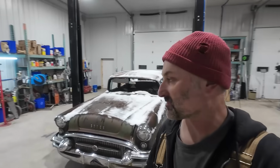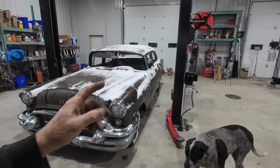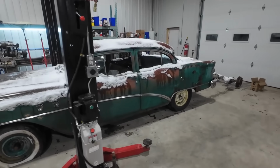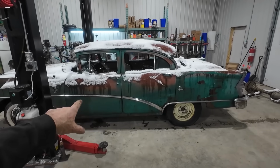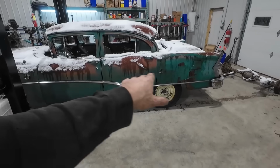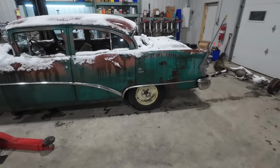Folks, you see me bring this thing in, that only means Austin's coming out, and tomorrow we're gonna start blitzing onto this thing. I think what I would really like to do is get the four bar into the rear so that the car's properly mobile. I know the last time we moved that, people were talking about how the diff is kind of doing a little dance, and because we don't have the original powertrain in there, that's what it does. It's a torque tube car, so there's nothing stopping it from going forward and side to side. There's a panhard in there, but that's about it.